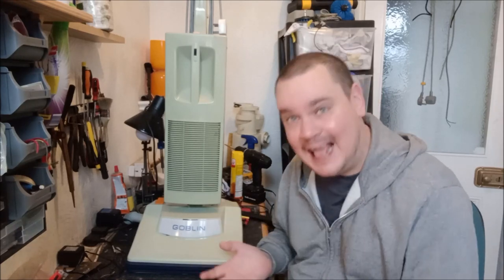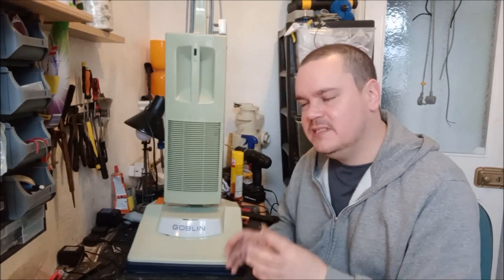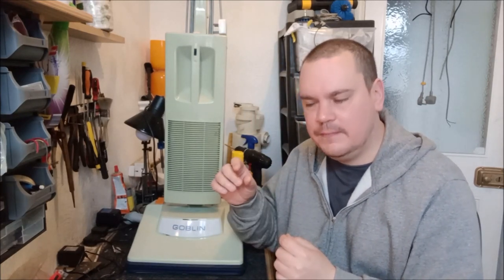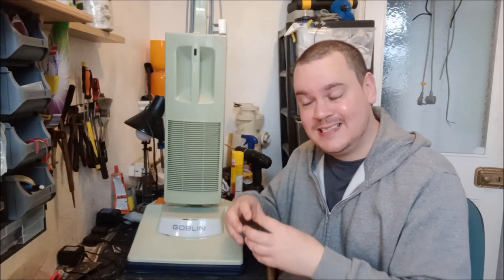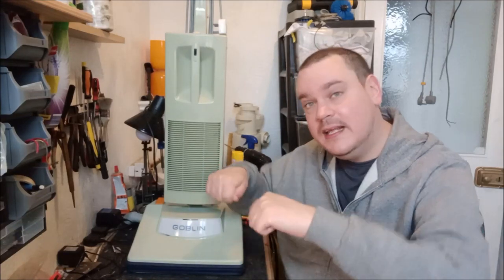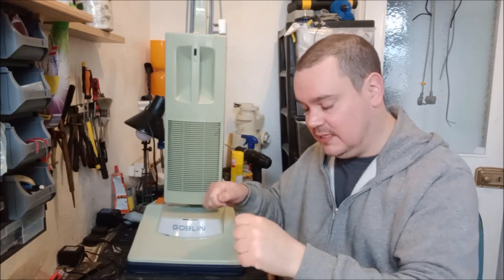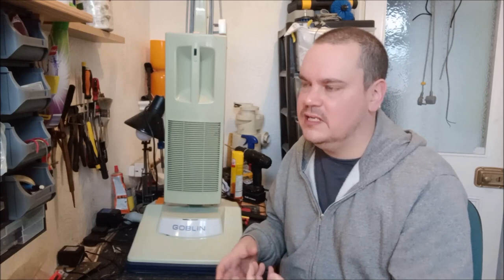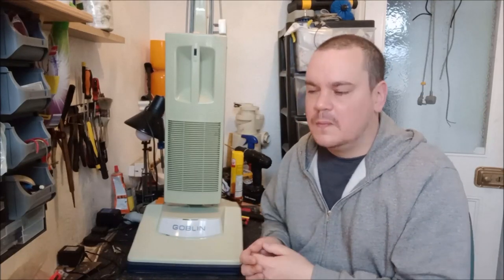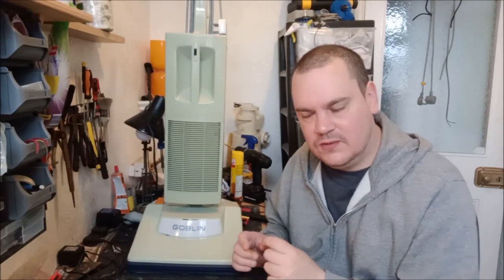So I took it apart again. This time I didn't have to take off the top end frame, because the field coil had already been taken out. I could leave the field coil out of the bottom frame. It is really difficult because there's very little access. And the more you do it, the more you risk breaking the field coil. So I've got that out and I'm playing with the fan side bearing.